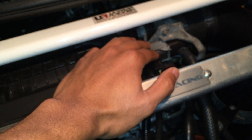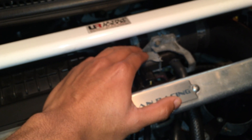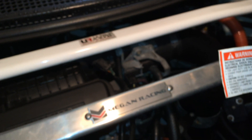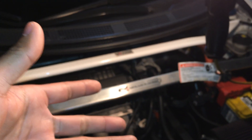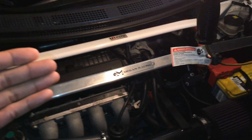I also got a couple other things coming through. The stock CRZ's throttle body is 50 millimeter. If you don't want to spend $1,000 on the spoon version, you can either take your stock one and send it out to Max Bore and they can bore it out for like a hundred dollars - but you gotta ship out your throttle body for about a week. Or you could do the cheap way like I did: just buy an R18 A1 throttle body which is 55 millimeter. Max Bore can make your stock 50 into a 55 for a hundred dollars. Spoon comes with 56 millimeters, so it's like one millimeter difference. It's probably not gonna make amazing power off of 1.5, but spoon is $1,000, Max Bore is a hundred dollars, or you go on eBay or the junkyard and you might find an R18 throttle body like me - I got mine for 10 bucks. It's coming in and I'm gonna swap that in when I do the build.